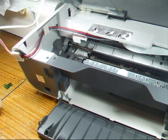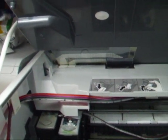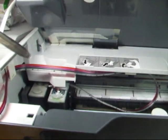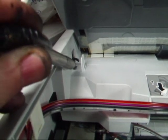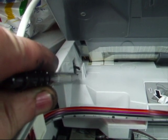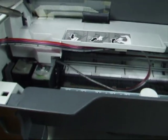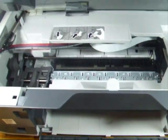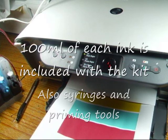The camera's in hand now so it might be a bit wobbly. The printer has been switched on and the cartridges have moved across to the left. Up here is a door catch — I'm pointing to a black door catch at the end. The lid normally comes down and pushes that catch, making the printer think it's closed. I'm going to put a pen in there to make the printer think the lid is down, and immediately the cartridges move across to the right — so now we can print.